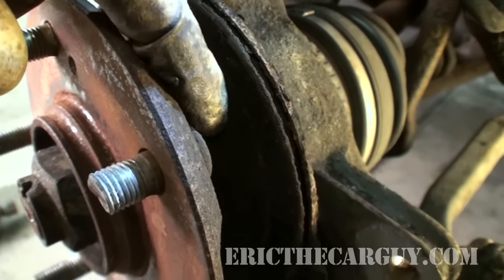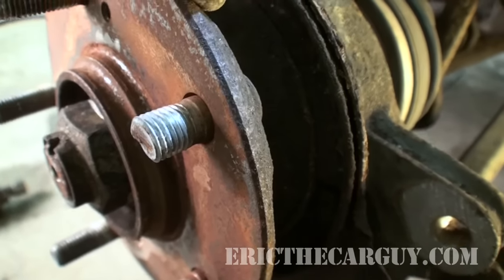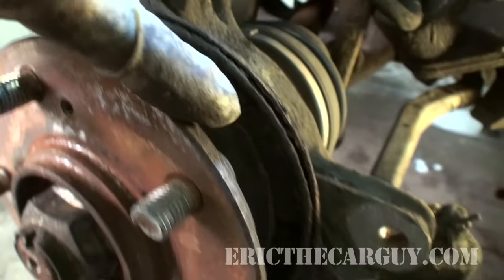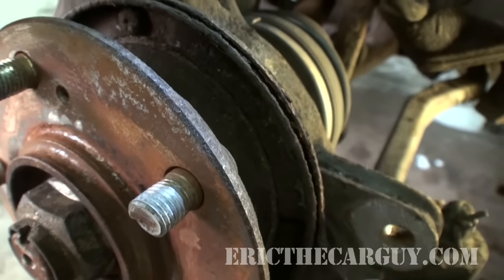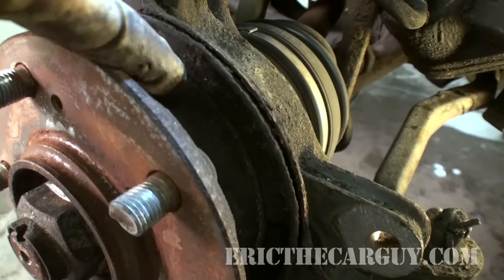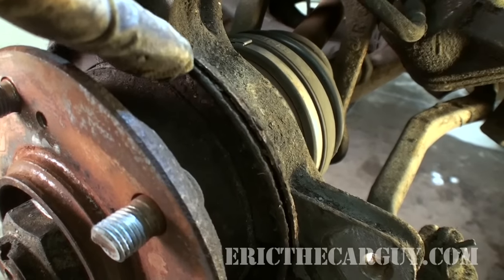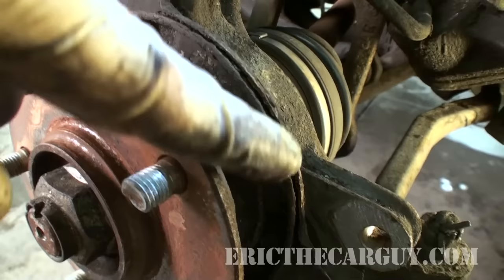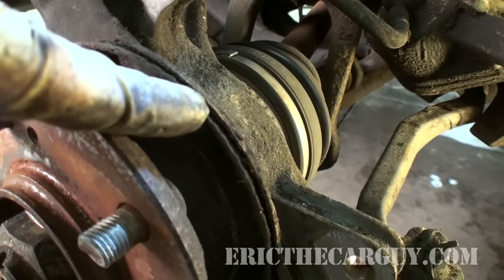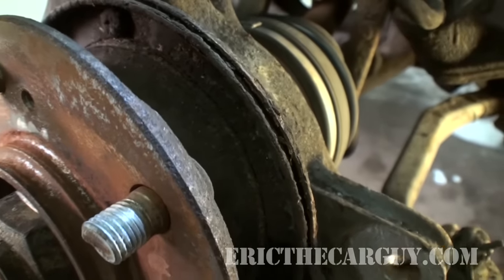I'll give you a heads up of what's about to happen here. I'm going to knock out this stud first, and then we have to get the new stud in, but this splash shield on the back here is going to be in the way. The only way to remove the splash shield is with the screws around the outside after the hub is removed. We don't necessarily want to go there, so what I'm going to do is cut a couple of slits here in this splash shield — I may cut it all the way off. The reason I'm cutting it rather than bending it is that bending deforms everything around the outside, which could come in contact with the rotor and make a noise. If I'm only bending one area as opposed to the entire area, I think I'll have a much better chance. So I've got my fingers crossed this will work.